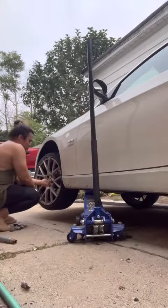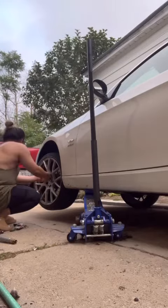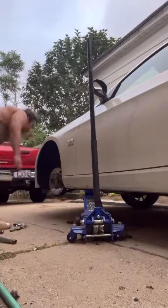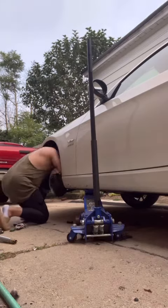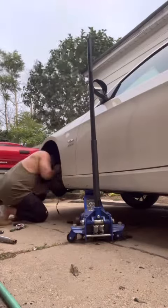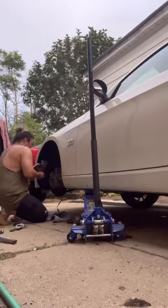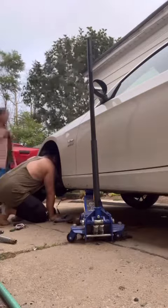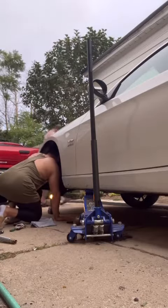That wasn't my case. It turns out it was my speed sensor. I replaced it with two different speed sensors at the beginning of the summer — people were telling me just replace your speed sensor and it'll go away — but it didn't work out for me. So next thing I was thinking I needed a new transmission, because my axle binding was happening. I was turning and the wheels were shaking and you could hear the axle binding.